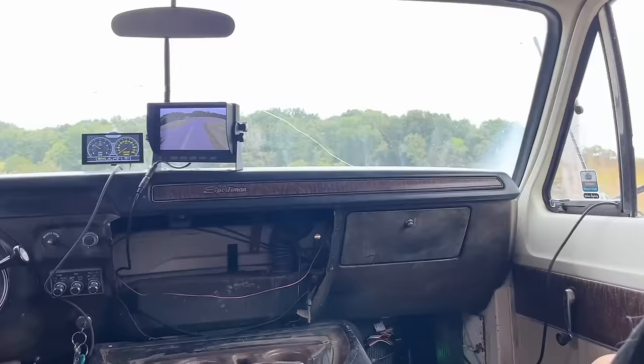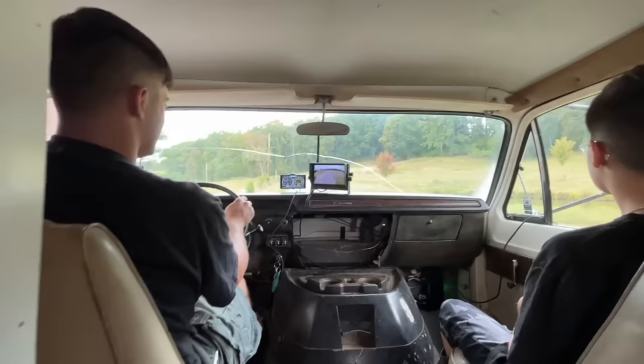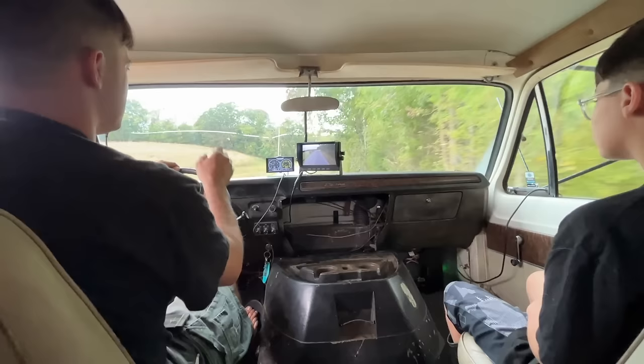Get it, girl. You can feel it surging, like it's trying to figure out what's best. I think we got a little too much timing in it for the 87 octane. I see when the timing gets up in the high 30s, I hear it rattle a little bit. Oh, I hear it too. Yeah. I probably need to back the timing down a little bit.